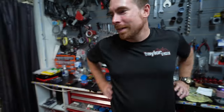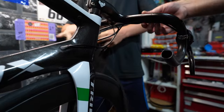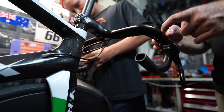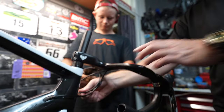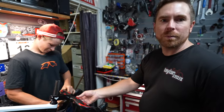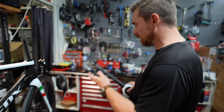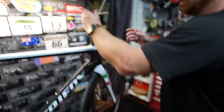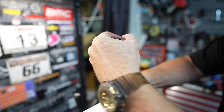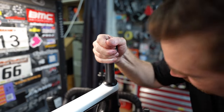What have you done with the cables? Put them underneath, just because it was too hard to get in the holes. Those small holes — you can't put the gear cable out that hole because it kinks. We could have spent another hour trying to get them through, but the holes aren't round; we'd probably have to drill and file them out. Bar tape to cover it anyway. Now to cut the steerer — on a normal fork you can get it down, but with the Trifox fork you've got to work at it, twist it.